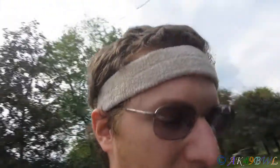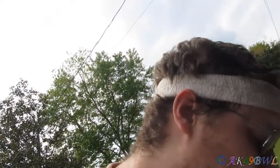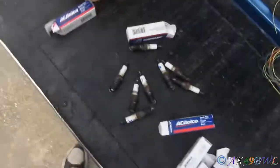No, I don't think it's the fuel pump, because we hooked it up to a fuel pressure tester up at my friend's in Dallas, or Fort Worth, and the pressures were good. It was dropping off real bad after the first prime and after you shut the engine off, and I still don't know what's causing that really, but it's not supposed to do that. But it's also not supposed to be cutting out when you've got decent pressure. So I'm hoping, now that I have both of those wires rehooked up and all new spark plugs, maybe it'll run a little more efficiently and not be cutting out on me. So we'll see. In the meantime, all of these are about to be thrown in the boxes just for the heck of it.